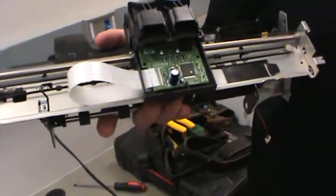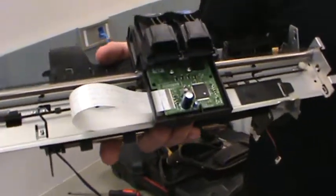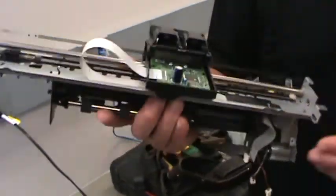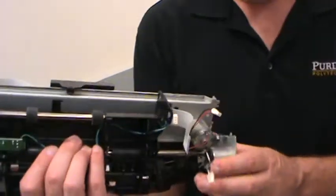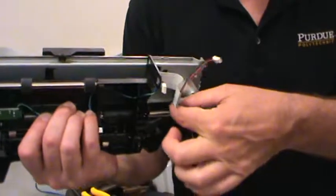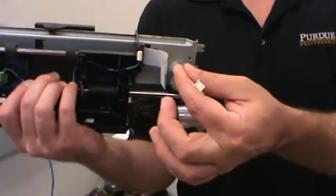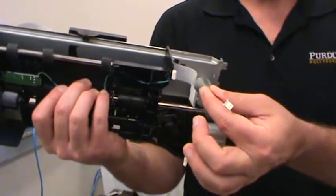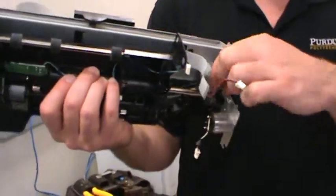Okay. What do you think this circuit is for generally? Did you guys decide that? It controls how the inkjet is operated. Right, so that controls the cartridges and makes them fire. Okay, good. And so you said it's a stepper. You meant that this is a DC motor. You can tell that they're using DC motors because this only has 2 wires coming off of it. Stepper motors have more than that, at minimum 4. Some stepper motors have 4, 5, and I think 6. But this is a DC motor.